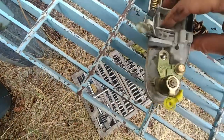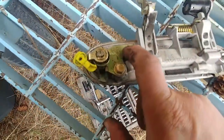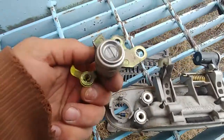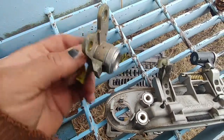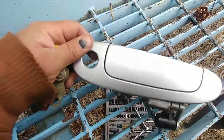It's disconnected. If you have any issues with the door lock or whatever happened to your handle — if it's broken — that's the way to do it. There's one bolt now holding the door lock cylinder; remove that bolt and you've got it. That's it — simple. If you like it, thumbs up. Take care and see you soon — I hope it helps someone.